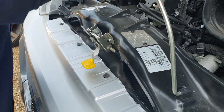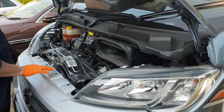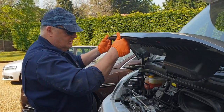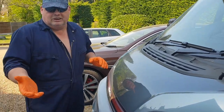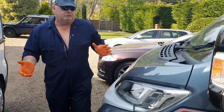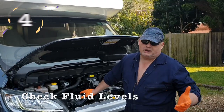Take the stay out, make sure the stay works. Anything that's mechanical and will move — keep it free. This may seem excessive but, believe me, I've been to a vehicle that's been sitting in a yard for two to six months and popped and broken the cable. So — bonnet up.